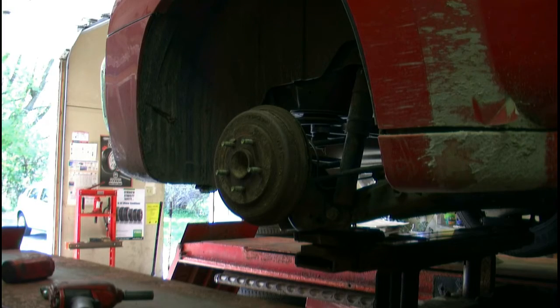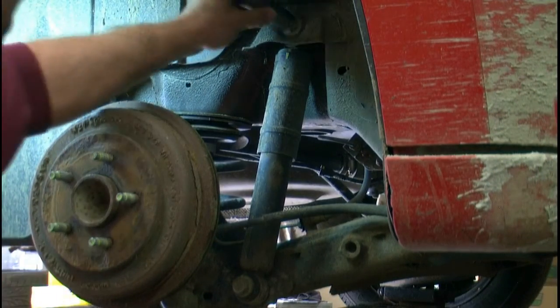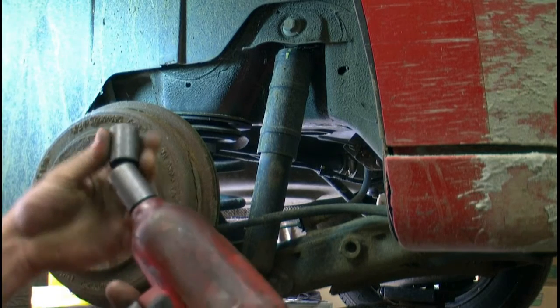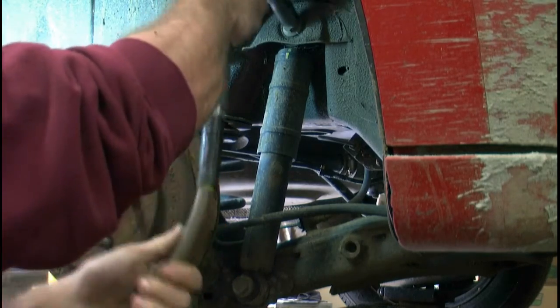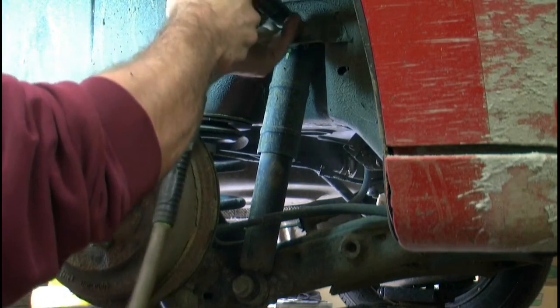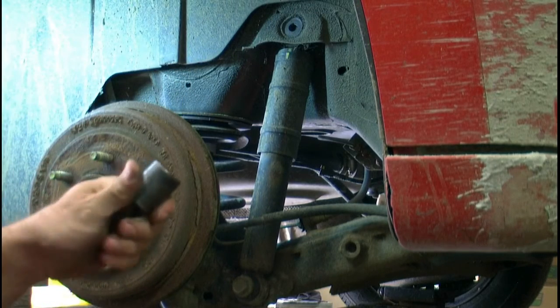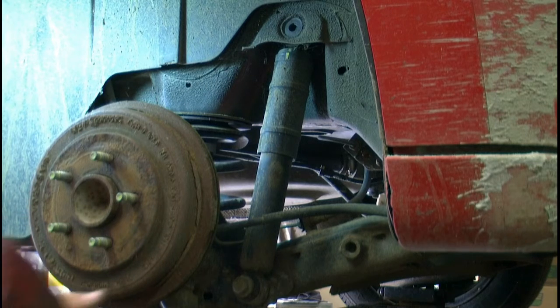Next step shows the shock. I'm going to start with taking off the upper bolt that holds the top of the shock in — 18mm socket, half-inch swivel, which is usually what I use. It just unbolts out. The bottom is going to be a 21mm socket — I use just a short, same swivel extension.